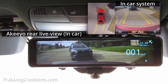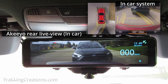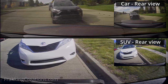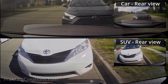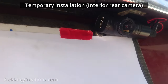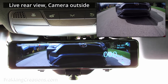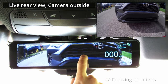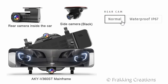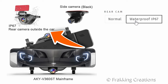When using this in the car, the trunk will still block part of the view directly behind the vehicle, so you can't fully see everything behind, but you will see more than with any rear view mirror. In an SUV however, there is no trunk jutting out, plus the camera is installed higher up so you get even more vertical coverage and can better see directly behind the vehicle. The ultimate setup for best field of view coverage is having the rear camera installed outside the vehicle. If you angle it low enough, you will have a really good view of what's directly behind your vehicle and can see how close you are to the curb or vehicle behind. Note that there are two options for rear cameras and one of them is rated IP67 waterproof. I recommend choosing the waterproof camera so that you have the option to install in the location that works best for you — inside or outside the vehicle.